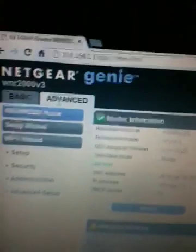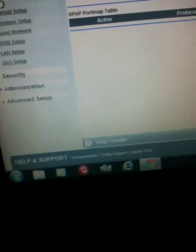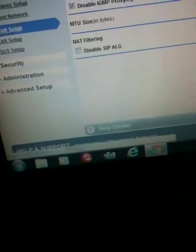If you want to fix your internet lag issues for the Xbox 360 lag compensation, go to your advanced settings in your router and then scroll down to advanced setup. We're going to click on Universal Plug and Play. First, go to setup. You want to take your NAT filtering and put it on Open. Hit Apply.